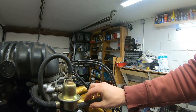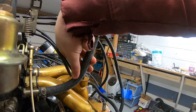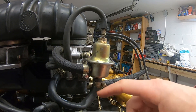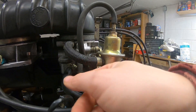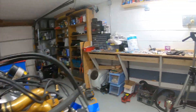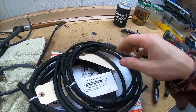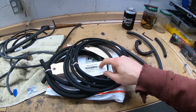Due to the difference in construction with the braiding being on the outside of these hoses, they hold a radius differently than a lot of other hoses. This hose from the auto parts store looked like the ID was pretty similar, but as you can see, it's just all kinked. If there's vacuum, they'll probably just seal themselves shut — so I'm going to have to pull it back off. I bought the correct hoses from Bellmetric; they've got good prices and carry everything you can think of for hoses, so I'll definitely be using them in the future.